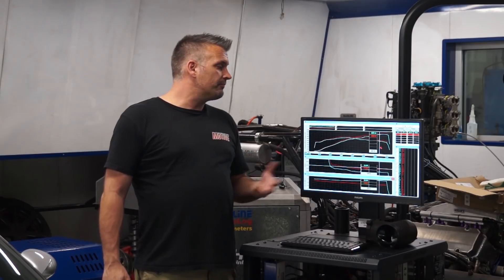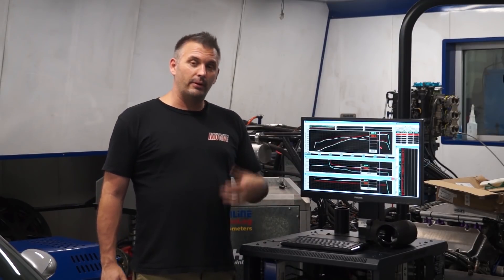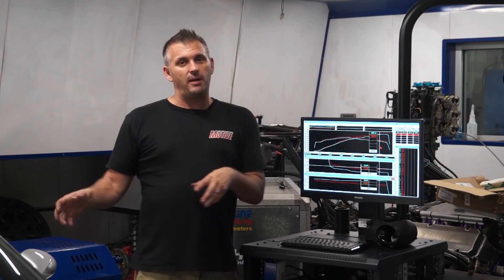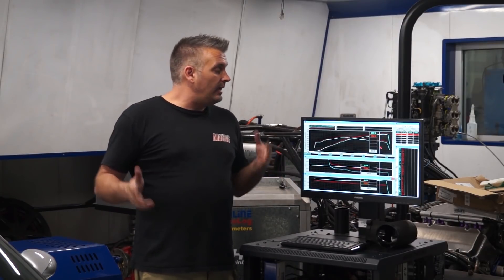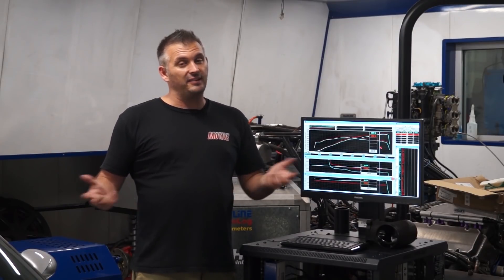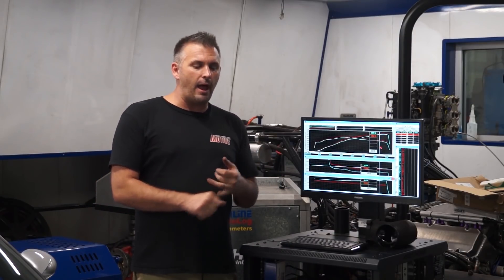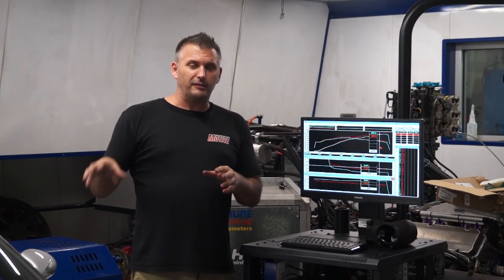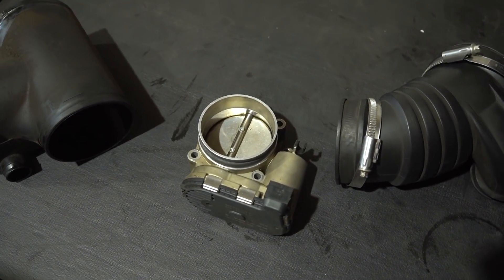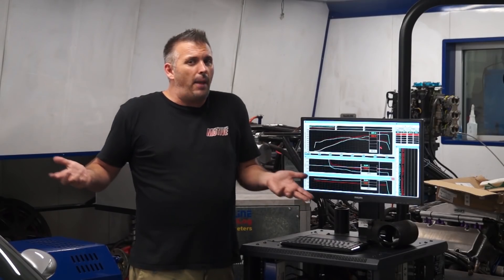Can we get that power back with tuning? Maybe — if we bring the air fuel ratio back up a point, that might outweigh the increase in intake air temperature, and we could bring the timing back. But as a bolt-on item, the K&N intake hasn't worked. Will it work with some aftermarket custom tuning? That's the big question. What all of this is really telling us is that there's no restriction from this inlet manifold all the way back to where the intake joins onto the boot lid. If there's no restriction anywhere, then changing things isn't going to make any more power. It's just physics.